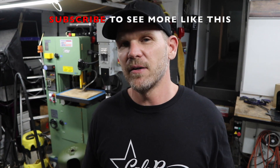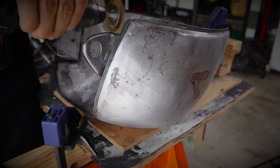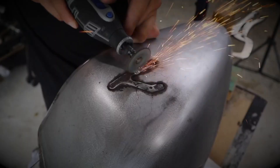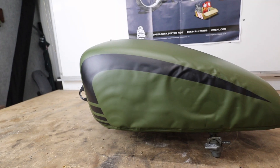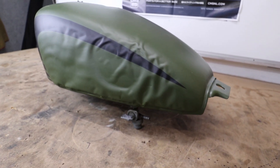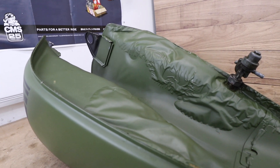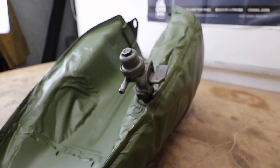When I painted this tank from scratch, the one thing that I didn't do was actually line the inside of the tank. There were some veins of rust and I kind of just cleaned them up as best I could. Even though the tank was completely spotless and free of all rust, there must have still been some rust somewhere in the seam — it made its way back through, leaked out into the paint job, and separated the paint from the actual steel. From there it just progressively got worse: it started as a small bubble, got bigger and bigger, and eventually the paint was completely destroyed.